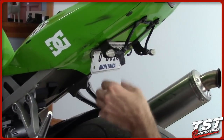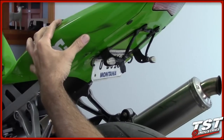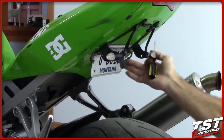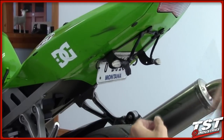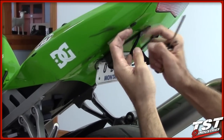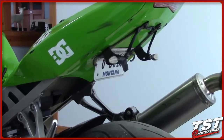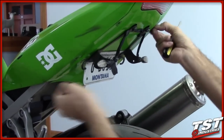These bikes have six push fasteners holding the under tail and the tail fairing together. They're located here, here, here, and the same three locations on the other side. These are removed by pressing the inside and pulling away from the under tail. Do that to both sides — remember, there are six of them, three on each side.